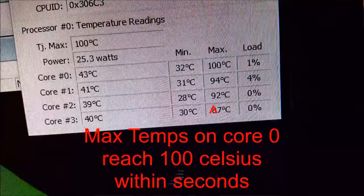But it all comes down to it. I've got my new favorite thermal paste here. And if something like this helps my 8700K now get to 5.1 gigahertz, that's an extra 100 megahertz, and that's an awesome thing. So if it can help people, then this stuff's really good. And I'm going to be using it from here on in, because I can't exactly use Liquid Pro or Conductonaut. I really don't like working with that stuff. Not only is it really hard to work with, but it's also conductive. So something like this is really easy to work with.